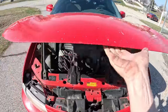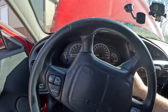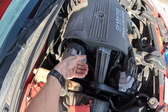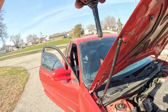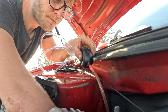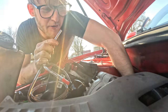The first thing we need to do is check the power steering pump because every time we start the car it screams — it's not supposed to sound like that. We have some power steering fluid and a pump, but the engineers put the power steering pump reservoir at the very bottom of the back of the engine so it's hard to get your hands back there. To help get access we're going to take off the coolant tank right here. That right there is our power steering pump — let's check the fluid levels. Very low. I want to get all of the old fluid out and put new fluid in, so I'm going to use this pump, stick it inside the reservoir, and then pump the old fluid out. The pumping bulb doesn't work very well so I'm literally just going to use my mouth to suck this out via a long tube — it'll mostly just fill up the tube.